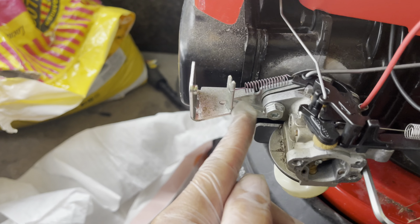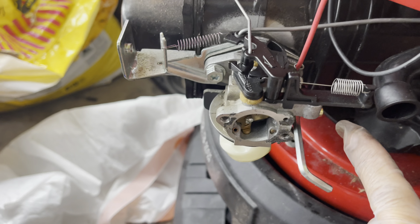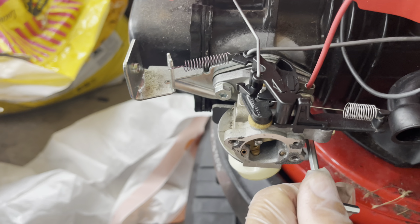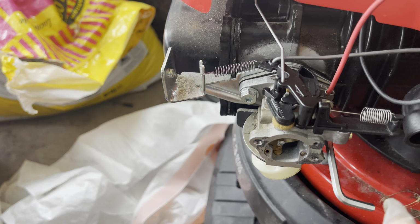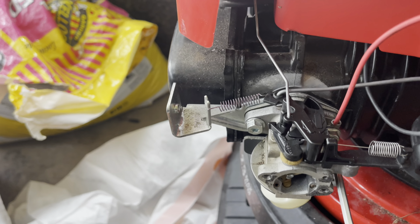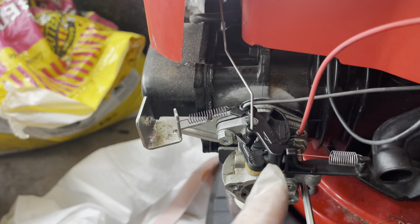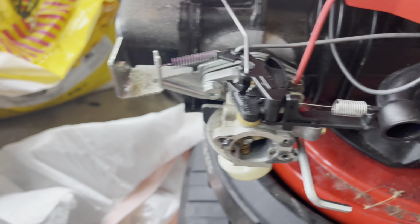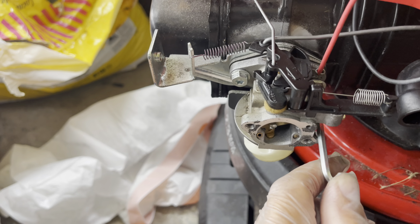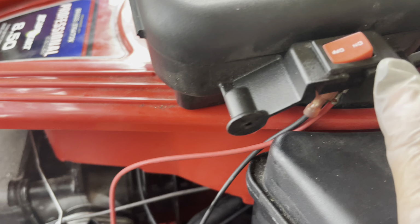So put it there, you can use a 10mm over here. On this side, you're going to use an Allen wrench because it's a little bit tight to use a box wrench or a socket. The last one, when you're all the way down there, you can use the 10mm box wrench to tighten this thing up. But right now I'm going to use this Allen wrench, and then you need to put this ground for your switch as well.